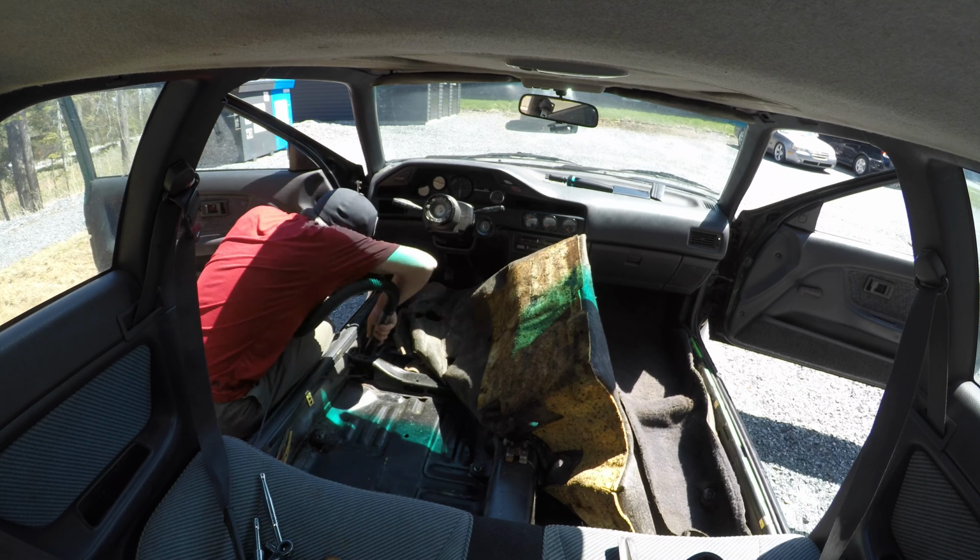Alright. This is this car's just about normal idle, at about 1,000. I've gone for a bit of a drive, to Dollarama and back to get this poison, and many stop signs, many red lights. No harsh vibration. I believe what I've done might have worked. I simply loosened the two engine mount brackets that are on the engine and then tightened them back up, thinking that maybe when we tightened them last night, it wasn't at the optimal position, so the engine was shifted just a bit. But man, what a difference it made. Now it's running smooth. There is always a bit of vibration, but it is to be expected.